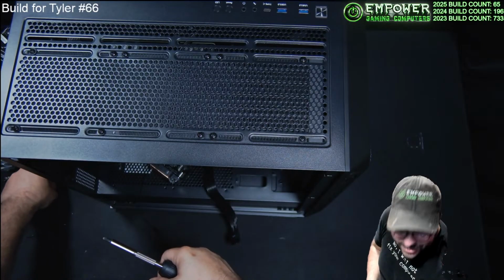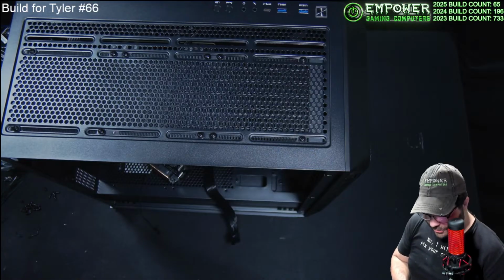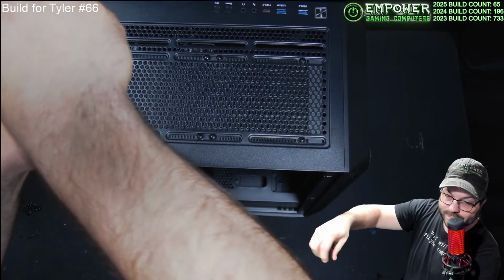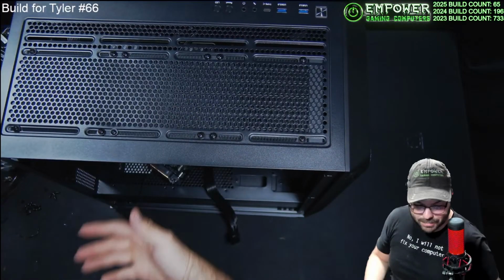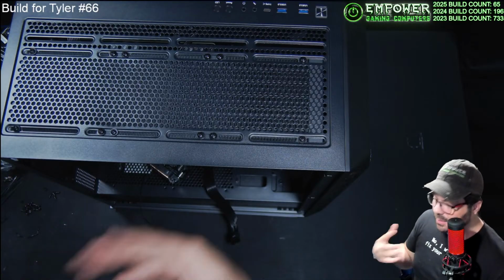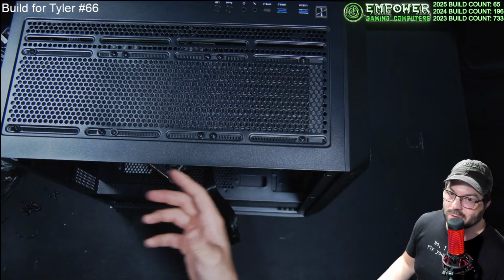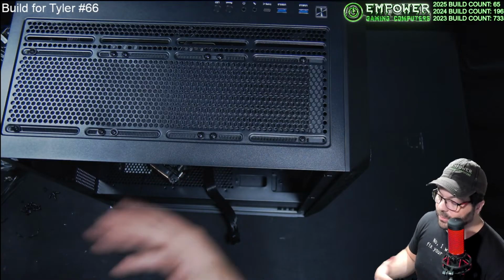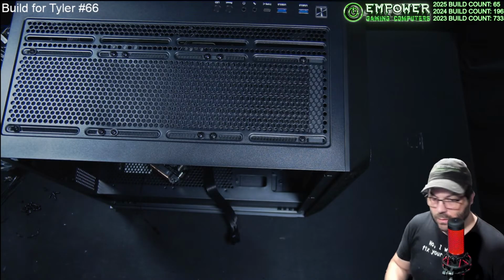Well, I don't know what to tell you, Joe. You need a wired connection, or you need another computer to download the Wi-Fi drivers to a USB drive. Those are the only two options. A driver is a piece of software that tells Windows what the hardware is, so Windows knows how to use it. Right now, Windows does not know how to use your Wi-Fi hardware. The driver will tell Windows how to use it, and then your hardware will start working when that's installed.